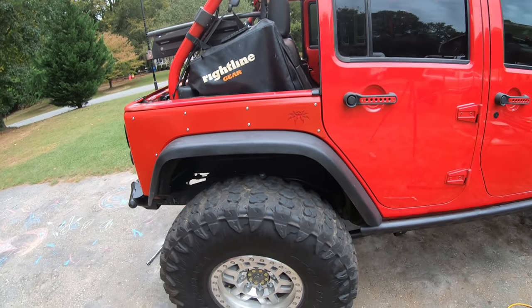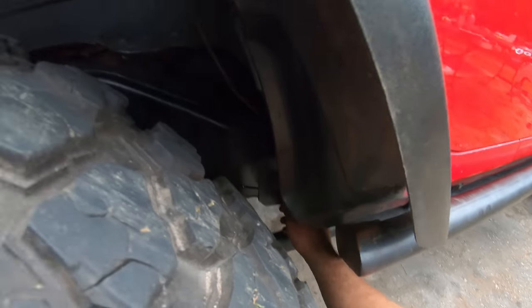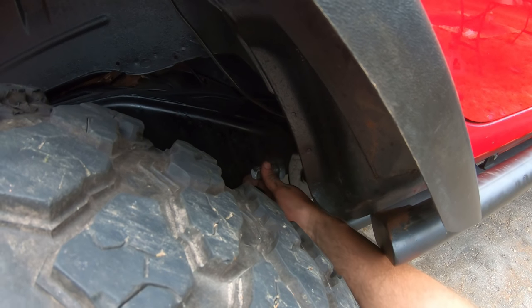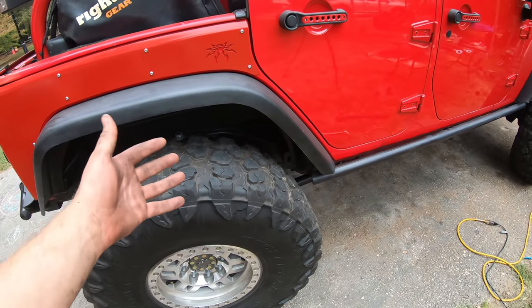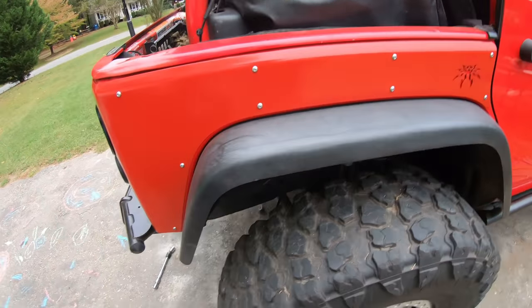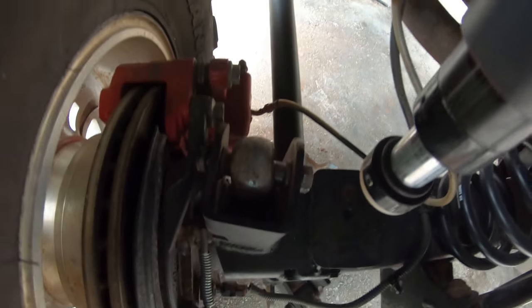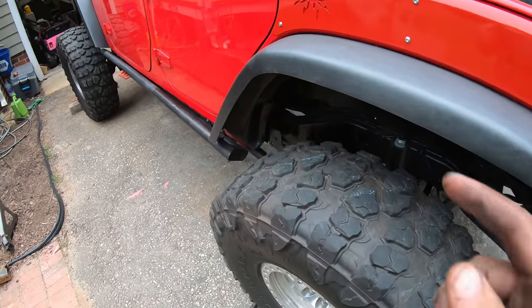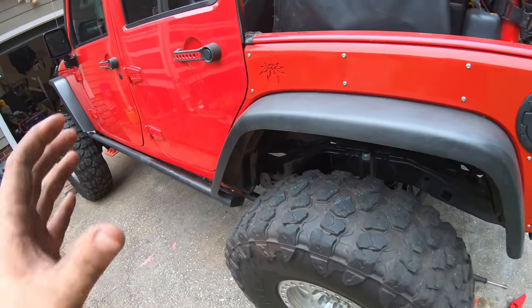The rear three-link is in — all we have left is to tighten down the jam nuts and bolts and grease the Enduro joints before use. I ran into some difficulties removing the upper control arms. The little flag nut that sits inside the frame is stripped, just spinning in there. The bolt on the axle side is also stuck inside the heim joint sleeve, rusted together. So both sides still have the joint on that fourth-link bracket — I just unthreaded them and took the arms out. We're not going to cut these upper control arms out since the lower link won't contact them.